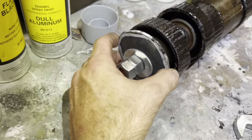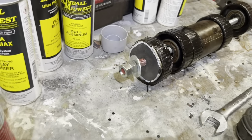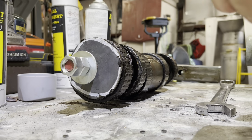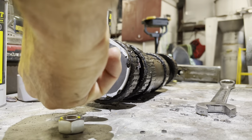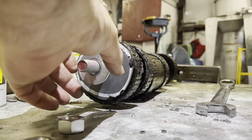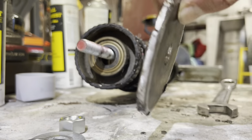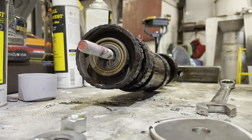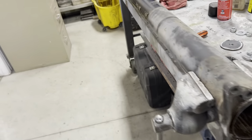And I made a steel plate instead of a piece of wood to pull out these bearings. Let me take it off, because it has to come off anyway to do the next torque tube that I'm fixing to do. The steel plate is about 3¼ inch diameter, and it's 1/8 inch thick. And you just put it on the rod. What I did is I ran the rod all the way through. I'll show you in the next video on the next torque tube.